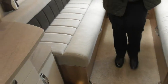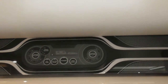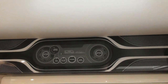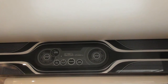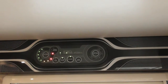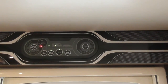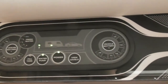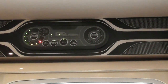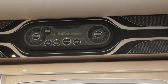So if you look above our heads — here's the control panel. I'll just switch the radio down. We can see there are no lights on it at all at the moment — everything else is up and running, so what's happening is the control panel's asleep. I can press any button just to light it up. The 12-volt system power switch is that one — that's your master switch. You always need that operating when you're using your van. If you press 'view levels' that's showing 14 volts on the battery now — it's putting a fair bit of power in. Before when I switched it on it was showing 12 with the electric plugged in, so I think it's taking a charge.